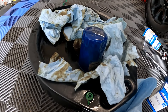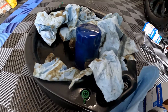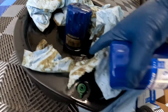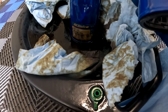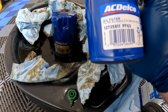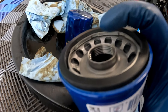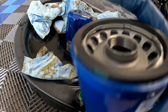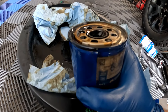I want to show one difference between the new PF63 and the old PF63. The part numbers are actually a little different — the one I picked up locally ends in 5811, and the filter from the dealership ends in 1742 (full numbers: 12735811 vs 12731742). There's also a physical difference: the locally sourced one has a slightly sunken-down flange on the very top, while the old filter was perfectly flat.